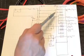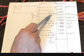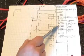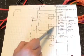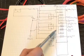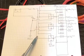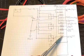Now our main relay, we've got another spare, which is another error because we need a Tach Module fuse, so that'll be used there. And then we've got a 10 amp feeding our MIL, our DLC, and our 2 pins for the ECU. It also feeds 2 pink wires for the transmission and a 15 amp to the mass airflow and 2 oxygen sensors. Main relay 2 then feeds bank 1, and that's the injectors and the coils, and bank 2 injectors and coils through 2 15 amp fuses, and leaves us another spare. And that pretty evenly splits the loads between the 2 main relays.